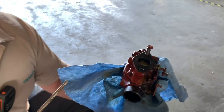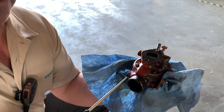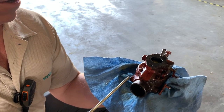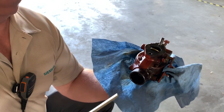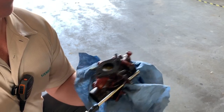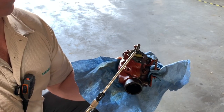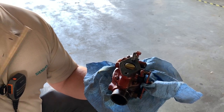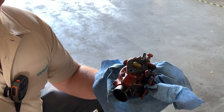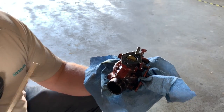To know if your carburetor cleaning is going to work: have your fuel bowl full of non-flammable cleaner — you don't want to put gas in it for this test. Take compressed air and blow in. This is an updraft carburetor; this is where the air comes in, it puts the fuel mixture in and goes into the engine here, so we should see fuel-air mixture come through here. The blowing in of air represents the engine running. I'm going to do that in slow motion so you can see it better.